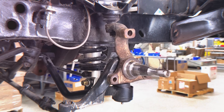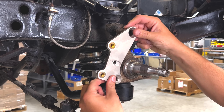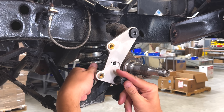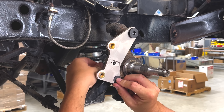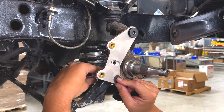The next step is to put the bracket on the actual spindle. This is a factory disc-style spindle, so you'll notice the spindle has a flat surface and the bracket sits flat on it. There's another version of the GM muscle car spindle that requires the included spacer because that surface is set back further. You're going to use a 5/8" flat head cap screw on top and a 1/2-13 on the bottom, going completely through the steering arm, with the supplied nylock nut and flat washer on the back.